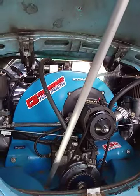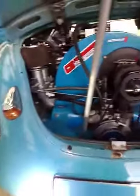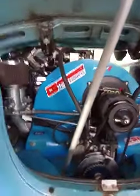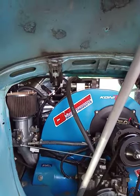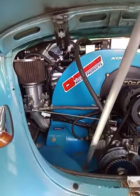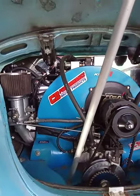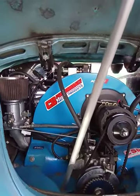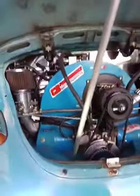For the Gen4, my initial installation — the pros. Everything that is required for the install is in the kit: relays, fuel hose, wiring, all gaskets — everything you need. Regarding the fuel hose, I've had a bad experience with ICTs before where the fuel hose supplied by CB cracked as soon as I bent it. So ever since then I've thrown away all CB fuel hose and replaced it with 20 bar fuel hose — that's about 300 psi. The fuel system only runs at 4 bar, so 20 bar gives you plenty of reserve.